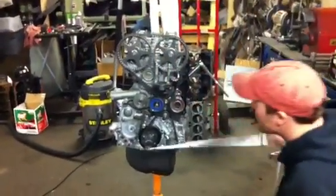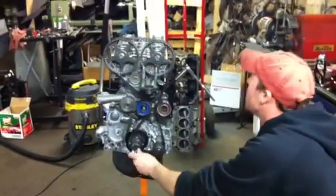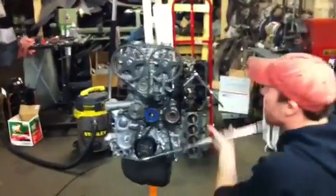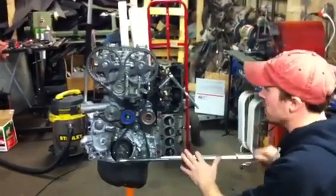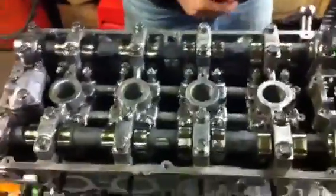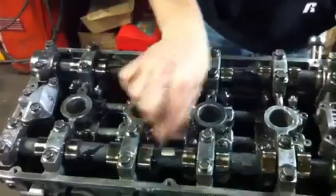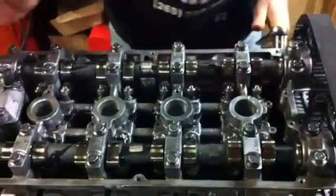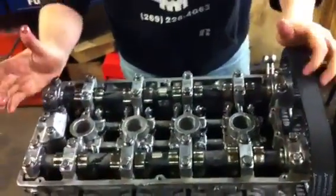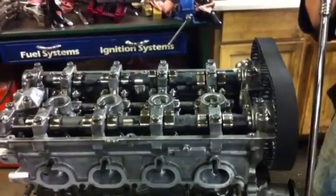If we turn it, I'm not really stressing out to do this — it shouldn't be hard. Nothing is technically binding. My crankshaft's spinning awesome, my cams are spinning awesome, nothing's really making any noise. If you don't have the spark plugs in, it'll turn like this — we don't have plugs in it right now because we don't want to be fighting the compression. We can look over here and see what our cams should be looking like, and make sure none of our lifters have any spacing between them. You can always grab them and do a quick last-minute check. Once you get oil pressure on these, all your lifters will inflate and your ticking will go away. This just shows you how easy these motors should be turning over — you should be able to do this with a short half-inch ratchet without a lot of problems.